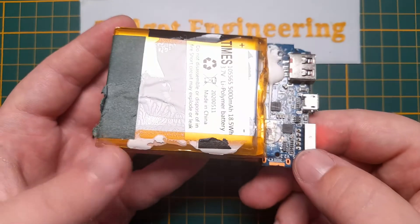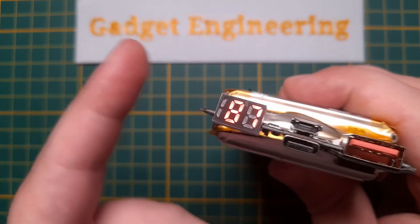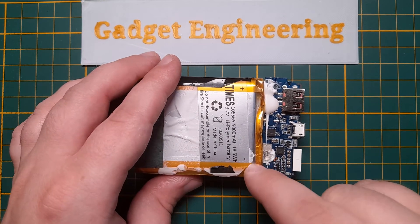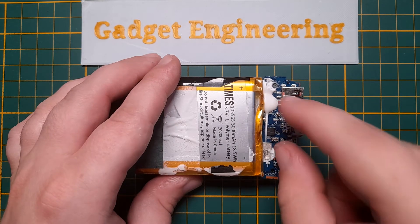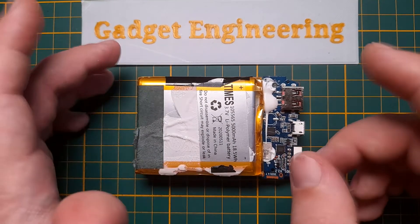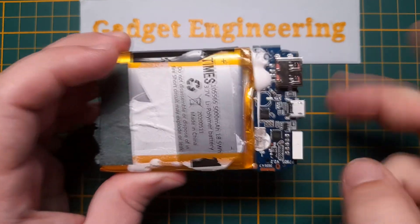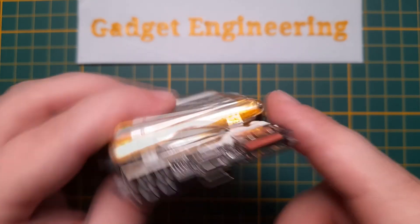If you're having a problem with your power bank — it's stuck in some mode, not outputting, but you can see it's still alive and it isn't a battery or hardware failure issue — you might have to reset the MCU. The only ways to do that are either unsolder the battery to take the voltage off the board and have it restart, or short the battery briefly with a fairly high-resistance thin gauge wire. That will pull down the voltage across the MCU for that short moment and reset your power bank. Good luck, thanks for watching, and see you next time.